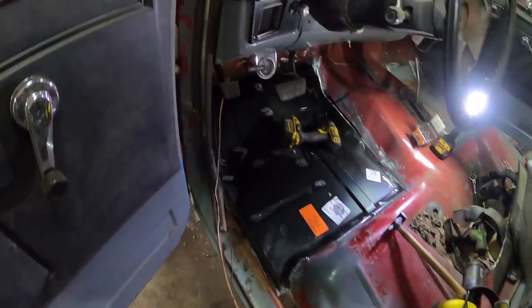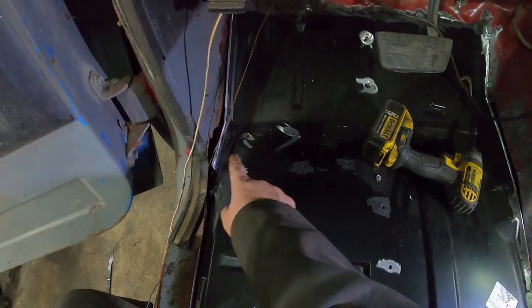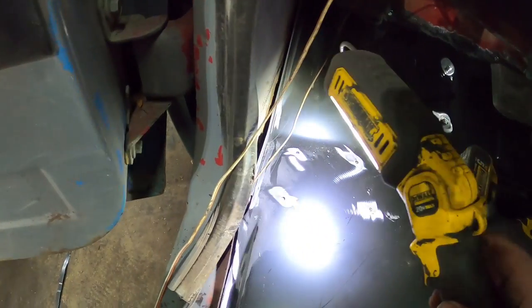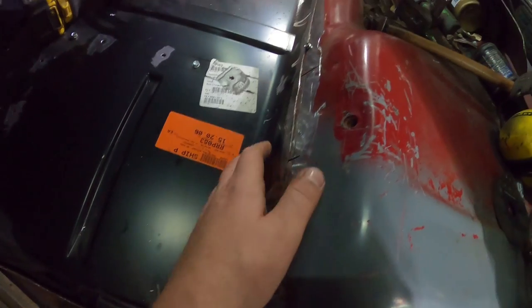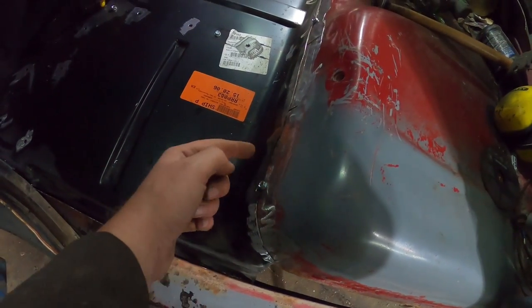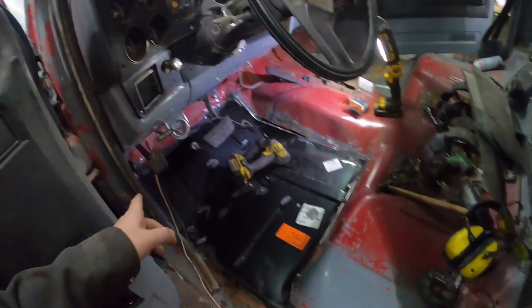Alright guys, so here we go - the pan is kind of in. I got a few tech screws holding it. These holes that I drilled out, that's where the brace runs front to back. And here is where the cab mount is side to side. I drilled correctly so I can plug weld all those - spot weld, whatever you want to call them. It's probably about a half inch or so of overlap. I put in these tech screws just to pull the panel in. What I'm going to do is tack it, then kind of cut with a zip cut, push it with the hammer, and just kind of keep going the whole way around. I learned that on a YouTube video - my buddy Rick at Old Time Garage. Go check him out, he's another Canadian guy. Tell him Dan says what's up. That worked out great.